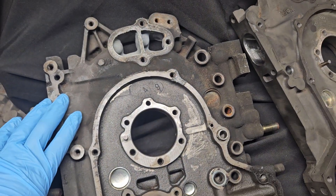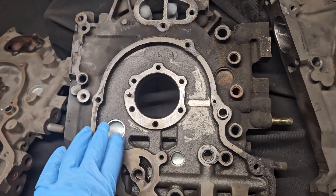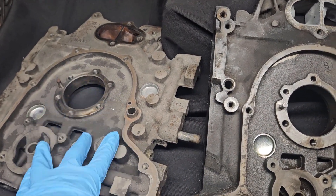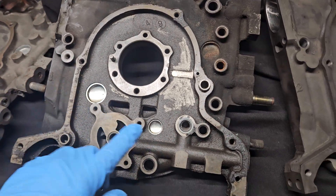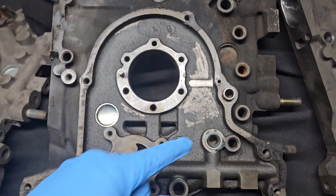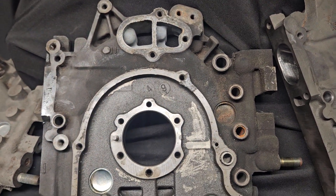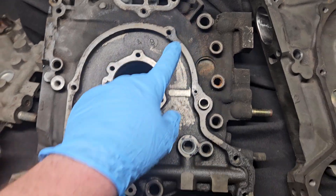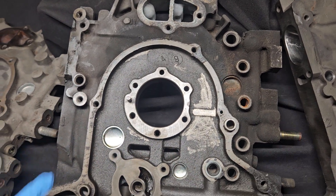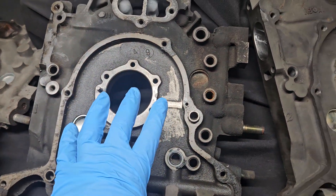It's kind of unique to build three rotors. When you're in a pinch or parts aren't necessarily available, one of the tricks we've learned at KMR is you can actually modify an RX7 front iron to do the job. There are two things you really have to take care of. One is you've got to open up your three rotor tension bolt holes — you've got two different sizes: your OEM size, and then they run two thicker tension bolts to that center plate. So you've got two bigger holes to open up, one up here, one down here, and then five OEM size tension bolt holes. Mazda put all the lands, or the bosses, cast in at the proper height, so it's really just a matter of machine work.